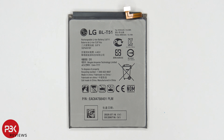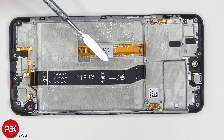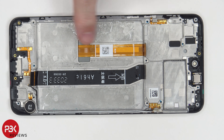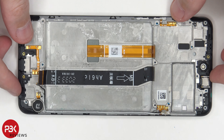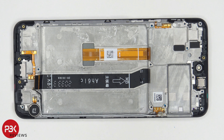Here's a look at your battery. You have two flex cables running underneath it, so when you're prying off the battery, make sure you're careful not to damage these cables. This cable over here connects your sub board to your main board, and this is your screen cable. So if you ever wanted to replace your screen, you would have to disassemble the whole phone to remove the battery and gain access to your screen cable, then heat the front of the screen to loosen the adhesive, pry the screen off the midframe, and reapply your new screen making sure to run the cable back through the opening.